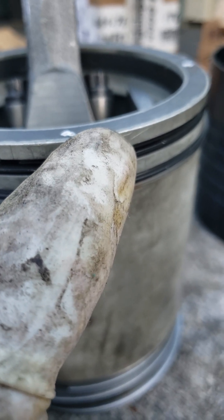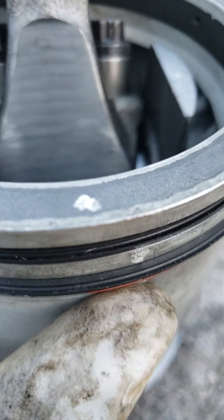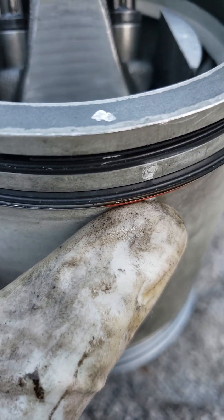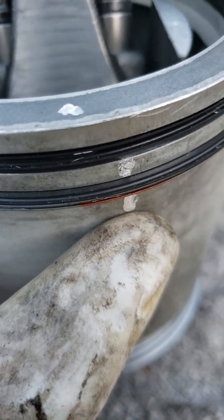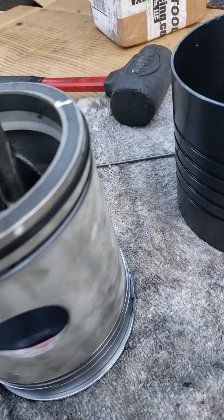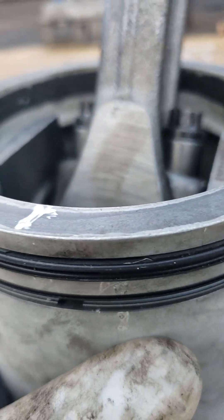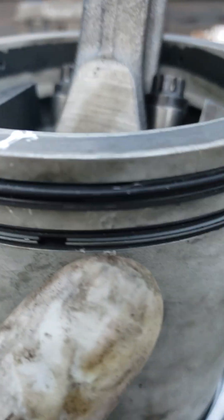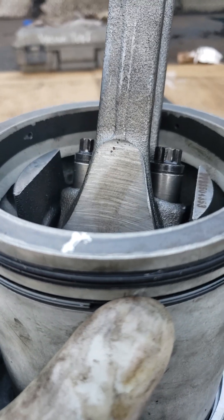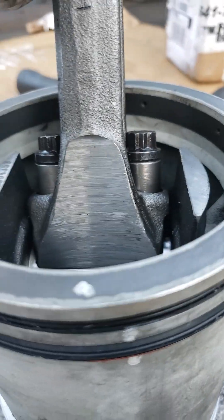While I was wrestling this one in, this ring moved — the overlap. I know where they're not supposed to be overlapping and where they're supposed to meet by these marks. So I quickly went and checked this one again, off camera, just to make sure it wasn't overlapping. Now I know this is pushed in — not overlapping on this side, not overlapping on this side.